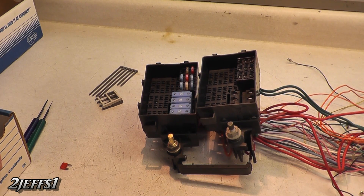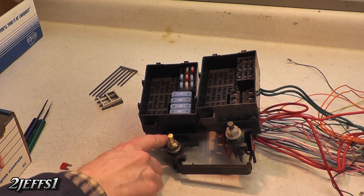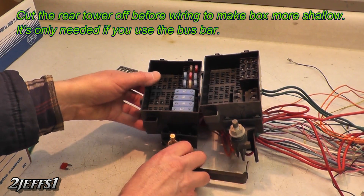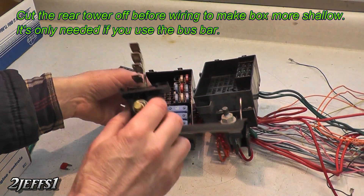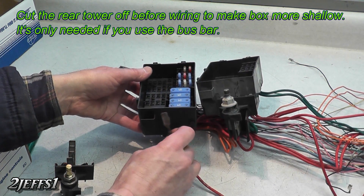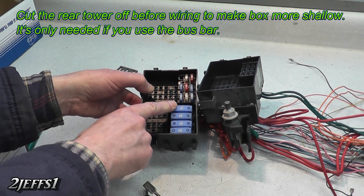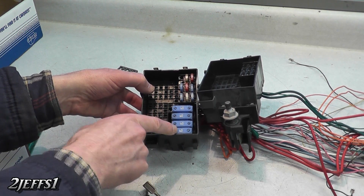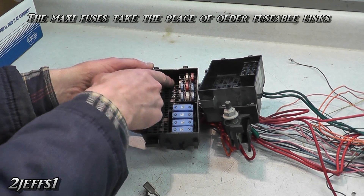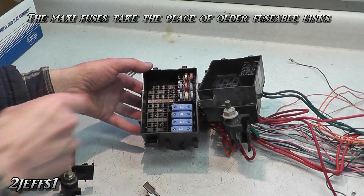These always come with the bus bar between them and the one that goes up to all your power distribution main fuses. I never really use those. What I do is just go with single connectors in — that way you can run like one to the battery, two for ignition, and one for accessories, then divide your circuits out into your separate ones depending on how many you have.